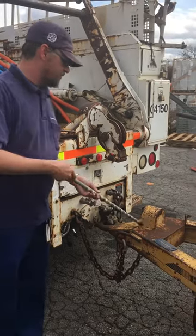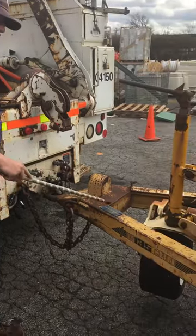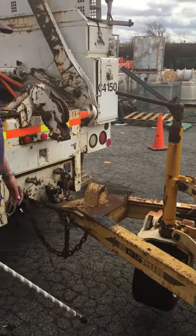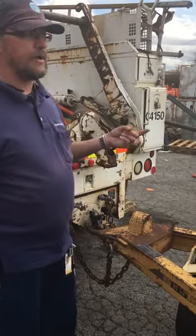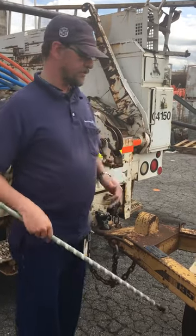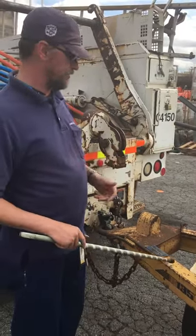So, we're going to go to the trailer frame here. I've got my longitudinal members, the cross members, the box and floor. There are six things we're going to check for: cracks, holes, broken welds, damage, and make sure it's not bent or twisted.